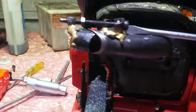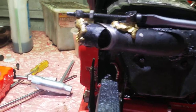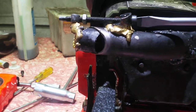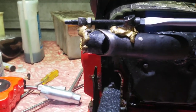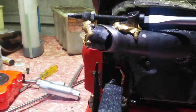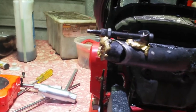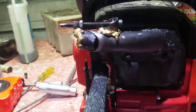I can make the hole bigger or smaller — right now it's coming small. So now I can work out what the go is, how much exhaust hole you actually physically need for these Chinese things. I've got 45, 52, 58 — this one's a 62. I've adjusted and cleaned it all up, got a lock nut there which is locked up.